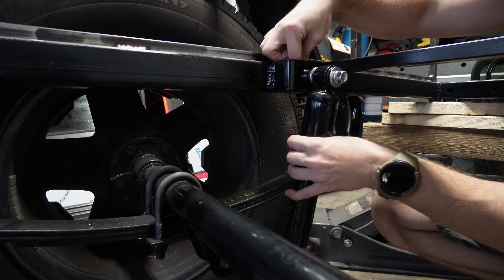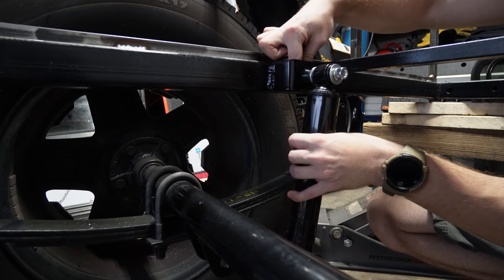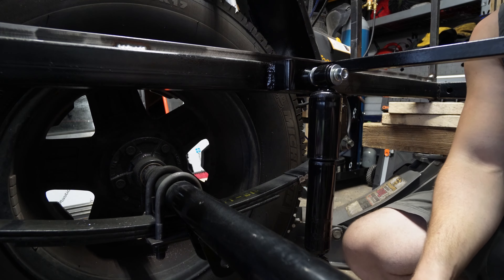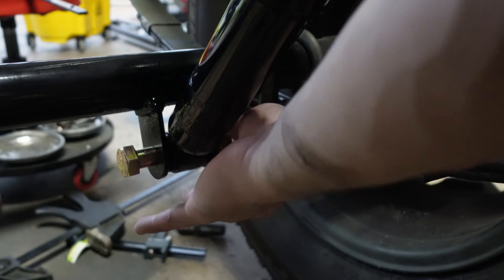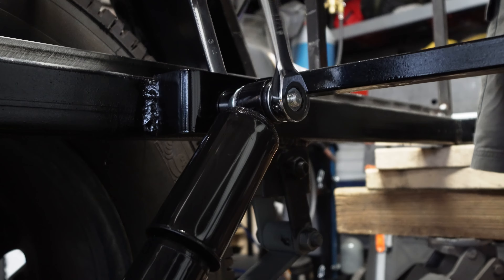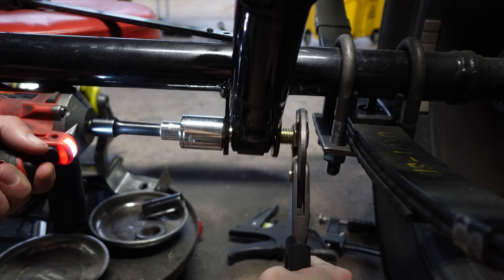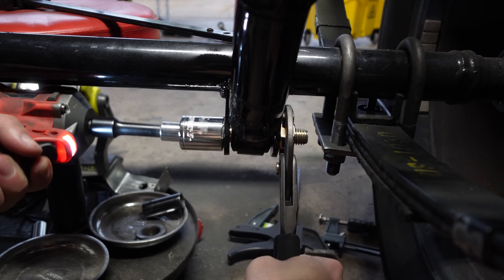Once the paint has dried, it's time to mount your shock. Go ahead and do the uppers first, get it pushed through and tightened. These Dorman shock bolts take an 11/16 and a 3/4 inch wrench and you're going to have to use a wrench because of the angles. Make sure you get both sides in before you tighten anyone too far down so that it all fits. This one is a 5/8 inch bolt with a 15/16 inch head. Once both sides are in, you can go ahead and tighten your shock. Make sure you don't over-tighten this — you want the shock to be able to still move slightly. Same with the underneath, go ahead and tighten it but not super tight because you want the shock to be able to swing a bit.